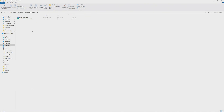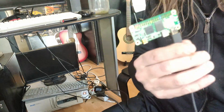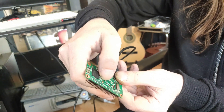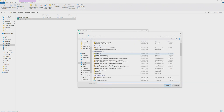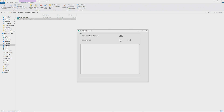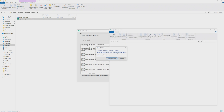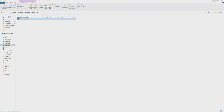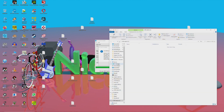Open the program you've downloaded — RZ USB Boot Helper. Take your Raksha Zero, press the small button on the back, and while the button is pressed plug the USB into your PC. Your PC should recognize it. Then click Select, choose the correct file, and click Run. After a few seconds you'll see it has found a file system — press Cancel. I always then use SD Card Formatter to format the drive before installing a new OS.